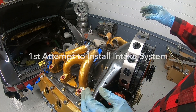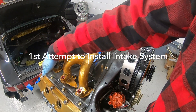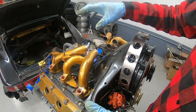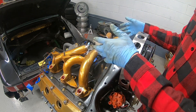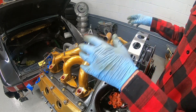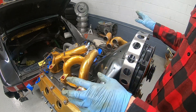I've taken all six runners and thrown them on here — I think they're in the correct order — and put one nut on each runner just to hold them temporarily. What I'm going to do is bring the whole fuel system over and jam it onto all these inlets, then undo the nuts, lift it off, and tighten all the hose clamps. I think that'll work.